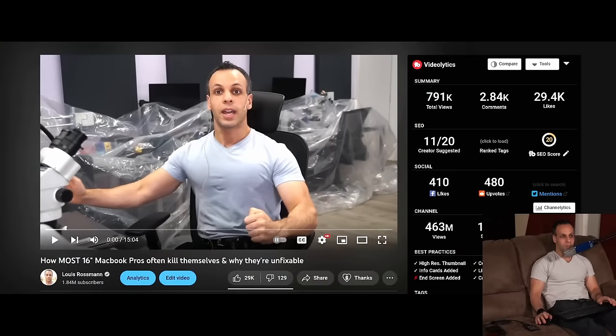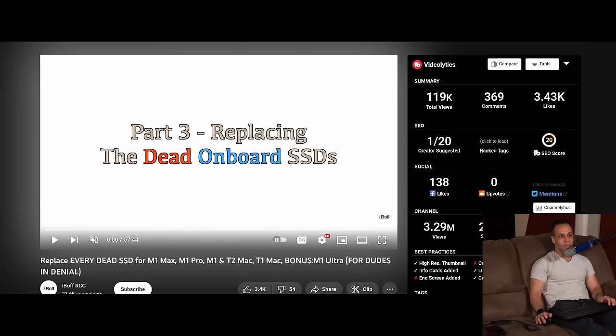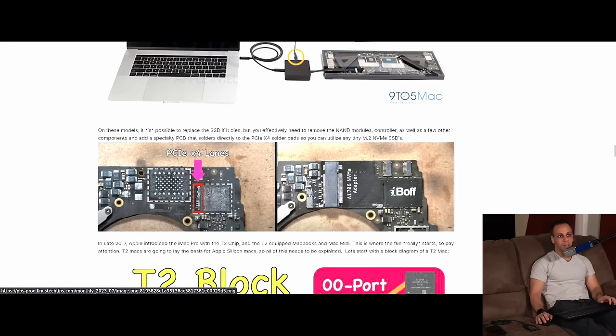If you want the TLDR, there is a three-part series that explains it far better than my 15 minutes of salt. There's a gentleman on Linus' forum who tried to do a TLDW of it. The absolute TLDR is that these NANDs are actually custom designs — they cannot be found anywhere outside of Apple devices, and cannot be purchased aside from Apple's website if you want a donor SSD. This is not a normal NAND; it has a custom ARM-based controller that runs its own miniature operating system as firmware and acts as an intermediary between the PCIe connection and the T2 chip for wear and other NAND management. You're not getting this NAND elsewhere.